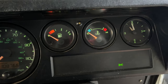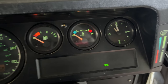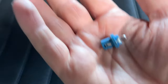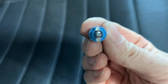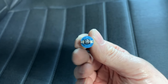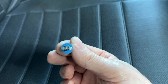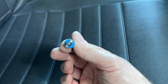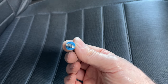There you go — fully illuminated instrument cluster! Replaced two bulbs in the speedo — I thought I'd do both while I was there because of the age — and the one in the temperature gauge. The other two, the clock and the fuel gauge, were already okay and they're still okay. Now be careful when you put them in because the 509T fits into an indent or cutout in the PCB on the speedo itself, then you've got to rotate it 90 degrees so the two metal contacts make connection with the board. If you turn it too far you may not actually make electrical contact, so if it's not lit up after replacing the bulbs, put the socket back in gently and tweak it a little bit with the lights on until the speedo lights up. You may just need to tweak it a tad.